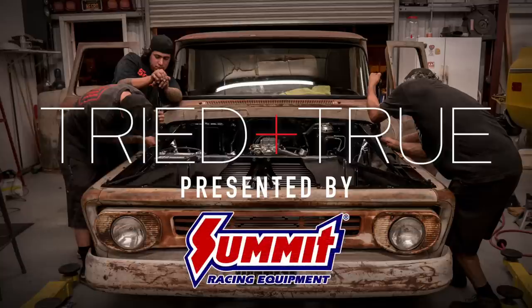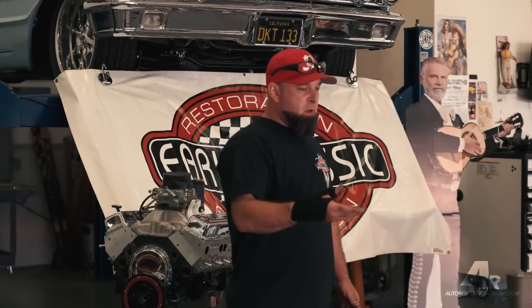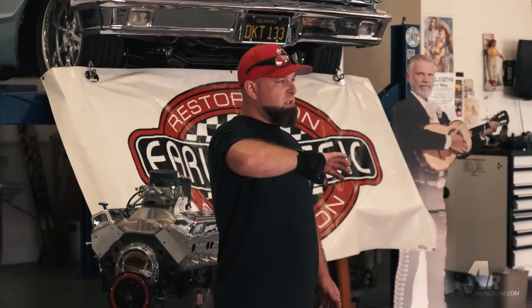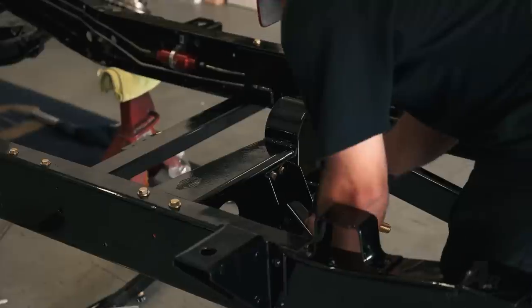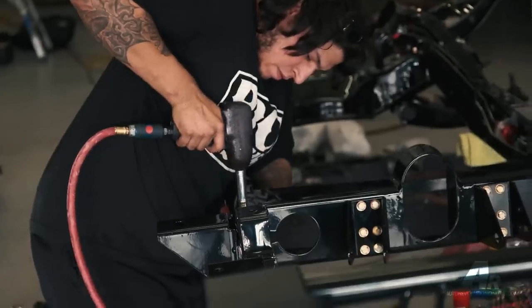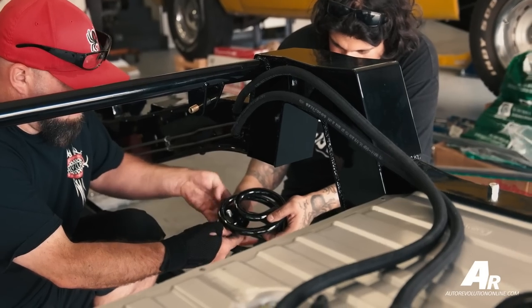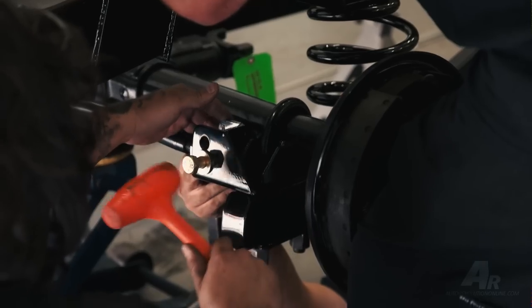Have it down at the Brothers Show Sunday. Well, what we've done is we've eliminated the hoop on the bottom and raised it on the top. We haven't changed anything as far as the trailing arm mounts. We've done a lot of research. We've found no reason to change the angle. More ground clearance across the bottom, and then more driveline clearance across the top.